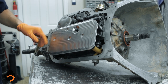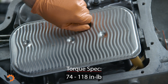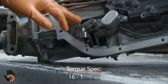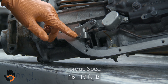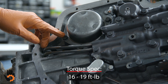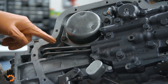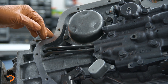The oil filter retaining bolt we like to torque to 90 inch-pounds. The park pawl bracket — there's no need to remove this during a transmission overhaul, but if it was removed, torque those bolts to 18 foot-pounds. The low reverse servo bolts we torque to 18 foot-pounds as well, using the star pattern followed by one last pass all the way around the servo to make sure we didn't miss any bolts.